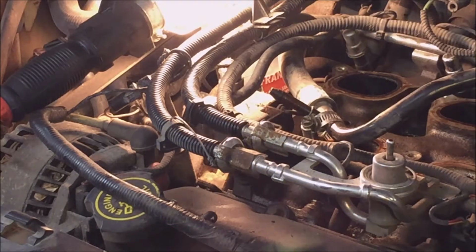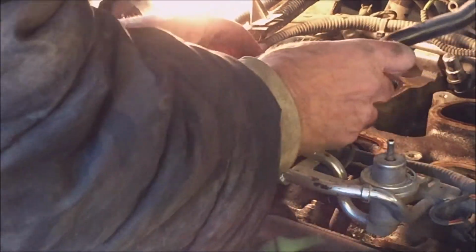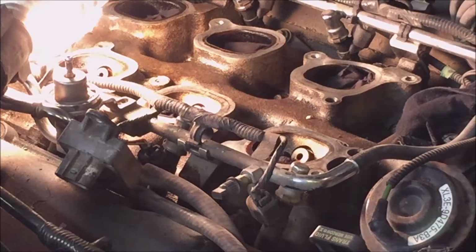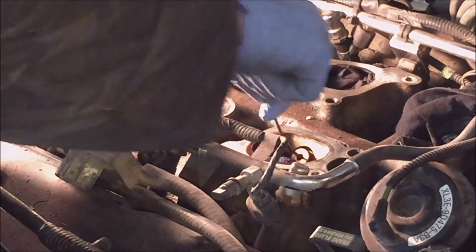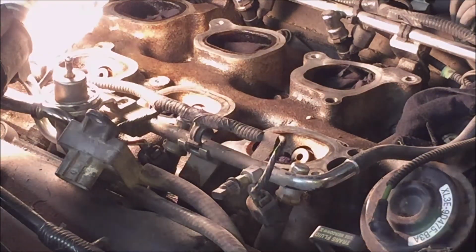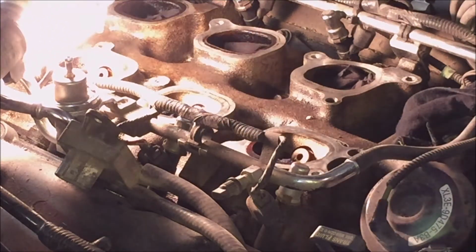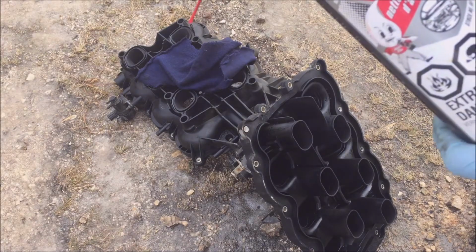Over here. There's a hump in the fuel rail. That's where you pull. That's where you get the connection out from. There it is. I got a small coat hanger. I'm just cleaning out the little holes here in the ports. And then I have some air intake cleaner, or you can use throttle body cleaner. And just give it a spray. And it comes out this side. What I did was I shoved rags in there so it wouldn't go down inside. Intake cleaner.